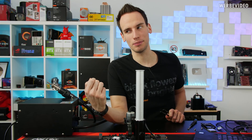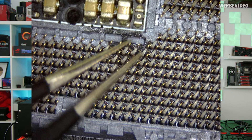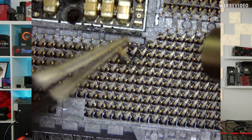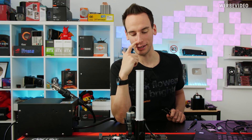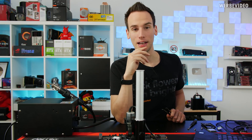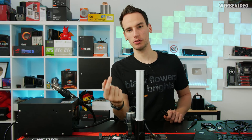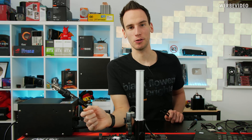I failed a little — while pulling out the broken pin, I accidentally also pulled out one of the good pins, so now we have two holes, which was not intended. But we have plenty of replacement pins and the board is already broken, so it can't really get worse. I'll try to push the two pins back, add a little bit of solder and flux to the back side, and see how it goes.